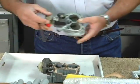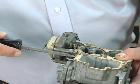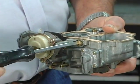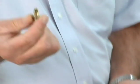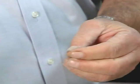valve, needle and seat, and the float. The carburetors have the basic three functions of the jetting. There are the idle jets, which are removable externally. And the holder comes out, and then the jet is plugged into the end of the holder. That's the part you change when you're tuning, and they come in a wide range of sizes.